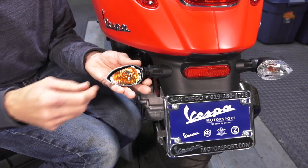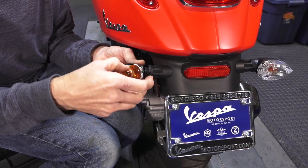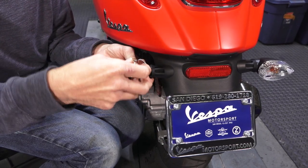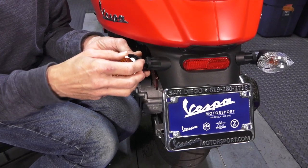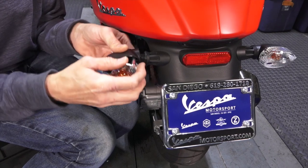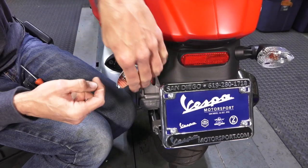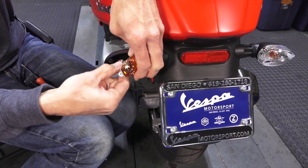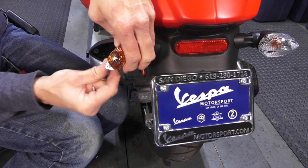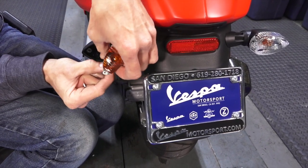Also, if you're going to change the bulb, that's how you do that. When you pull this out, you're going to see a pair of wire terminals — one's disconnected, which is pretty common. Pull the reflector out and then you can reseat the turn signal. That gives you a little more slack to reconnect the short lead for the rear turn signal. It's common that these rear ones — you bump them with your leg and they just fall right off the rubber stock.